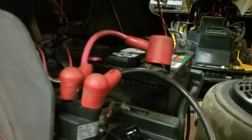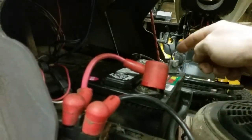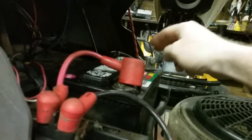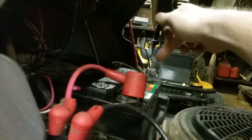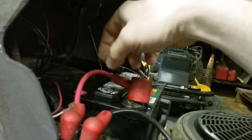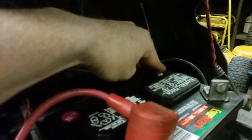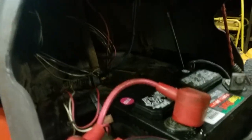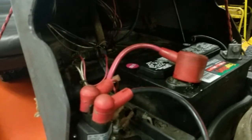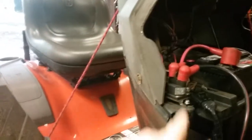This is the mower we worked on before where the lady got a battery and put it on — they gave her the wrong battery. They make batteries with the terminals in reverse. Originally the terminals were sitting back here, and she turned the battery around. The negative ended up on the positive side and the positive on the negative — she hooked it up that way because that's how it was from the factory. When she got the reversed-terminal battery and hooked it up that way, it shorted out her regulator.